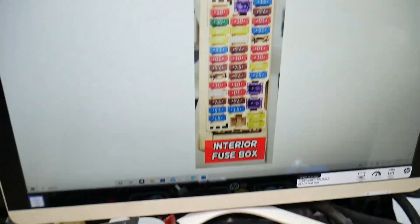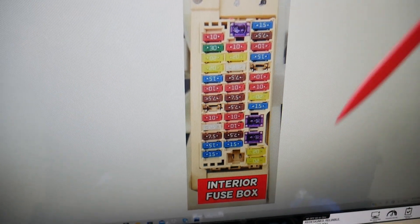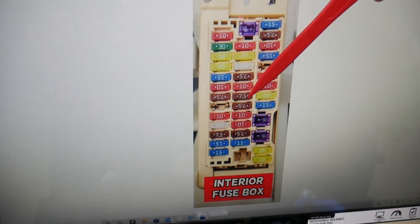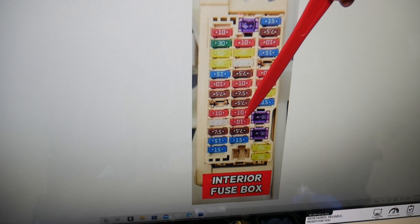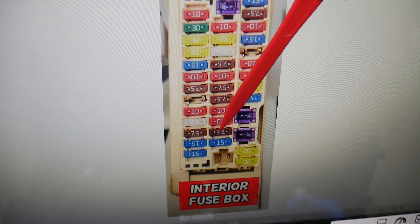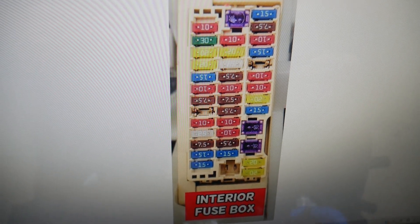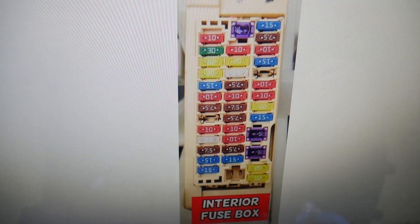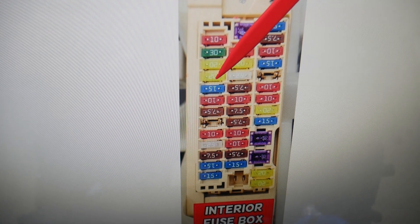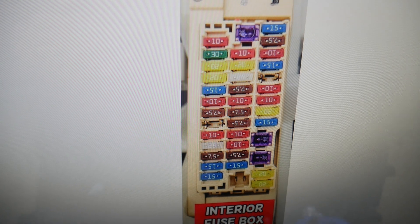Specifically here we need to check two fuses, then go to a different fuse box. Come to that middle row right here. Fuse number 23 — that's a 7.5A fuse — will need to be checked. After that, you will need to check one more fuse for the rear wipers: fuse number 28 right here also needs to be checked.